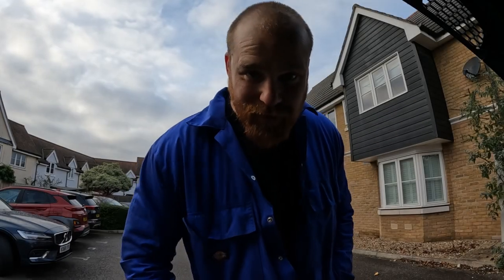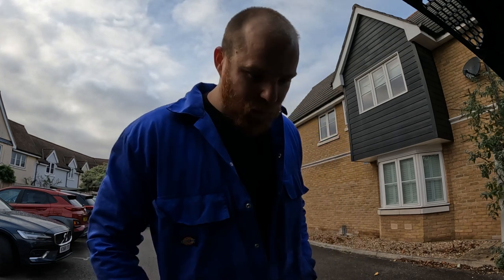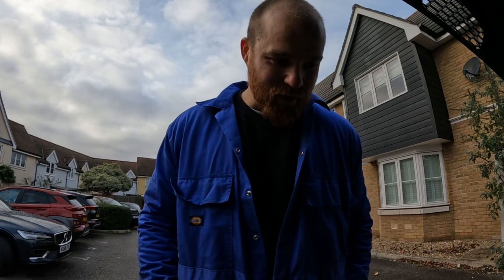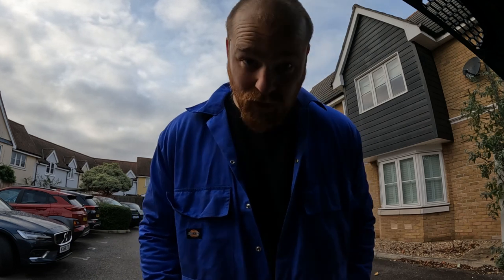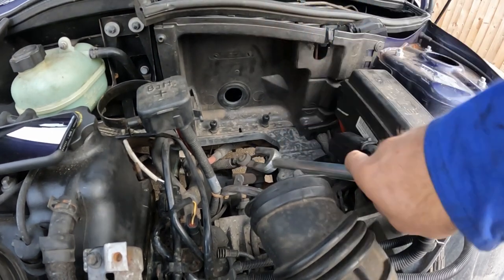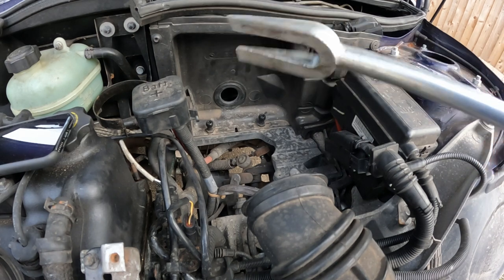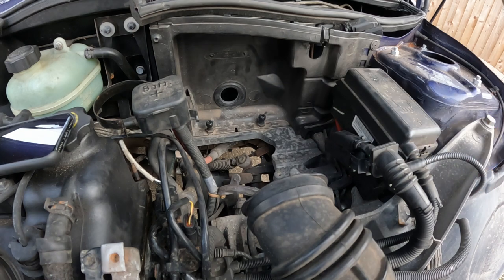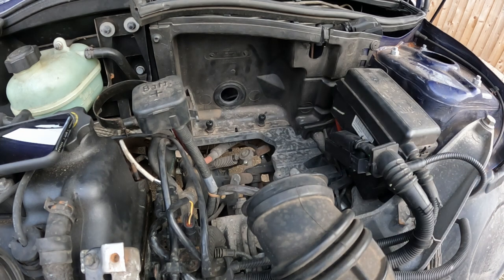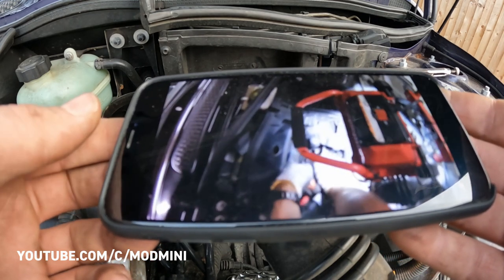Good morning — it is now the next day. Got rained off last night. We've still got loads of steps and loads of work left to actually get this gearbox out and complete the clutch change, so let's crack straight back on. I'm using this ball joint separator doubled up as a pry bar — don't knock it till you've tried it. Under here you need to force it upward; sometimes you need three screwdrivers, but I did it with one.